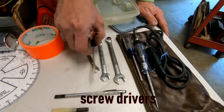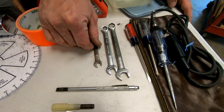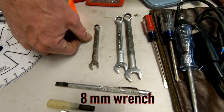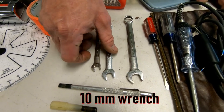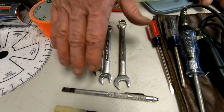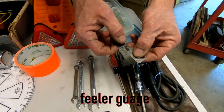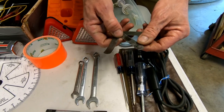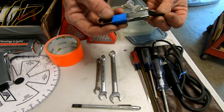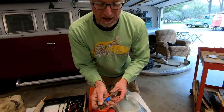Flat blade and a Phillips screwdriver — easy to access, those are our keys right there. These are your most common sizes: 8mm — that's your barrel nut on your carburetor; 10mm — that's for your distributor; 13mm — that's about everything else on a Volkswagen. If you're getting into other things, we go back into our bigger bag. Here is our feeler gauge. We've got our three main things: valves, points, and spark plugs. They're already set; I've got these three because these are my go-to items I'll be using all the time.